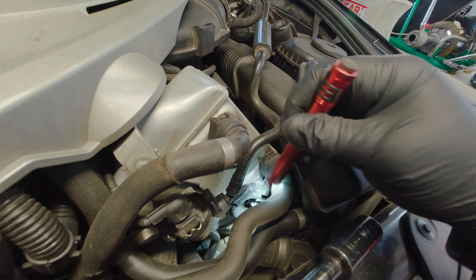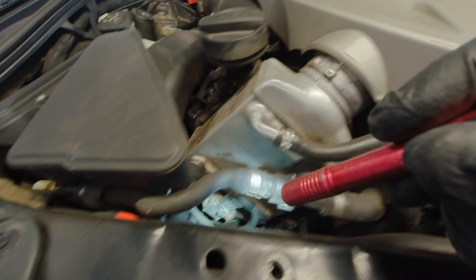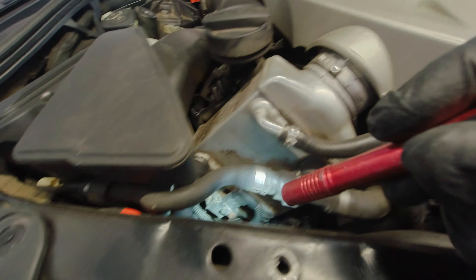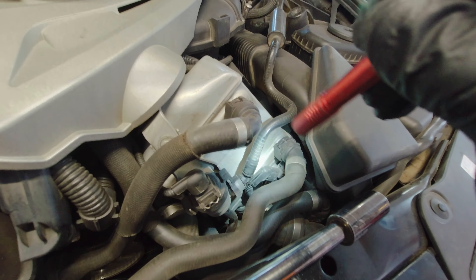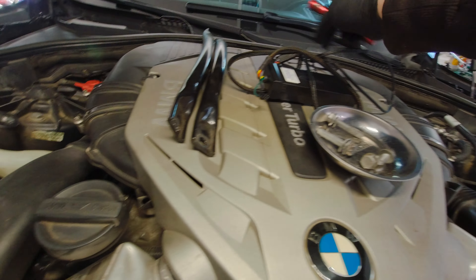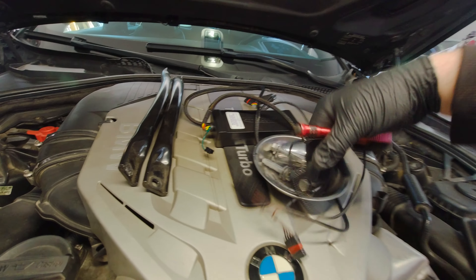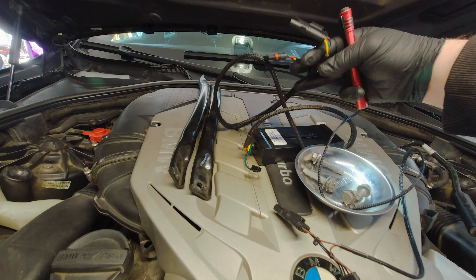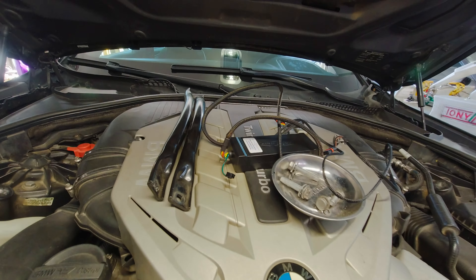So what we're aiming for is the T-map sensor here. We have one over here in front of the intercooler and another one over here. We're going to use the good old pick on the back side and pick those out to get the two connectors off. The two connectors here — I kind of thought they were both T-map, and I'll confirm because the coloring is different.